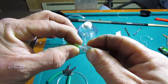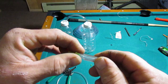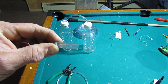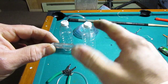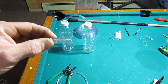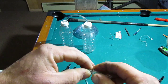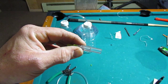I'll take this apart and attach it to a 10-foot piece — however long, it doesn't matter how long the hose is because the vacuum is going to pull just the same. You're looking for a vacuum port on the load side of the carburetor, which is the engine side. If you have a butterfly valve that opens and closes via throttle, you want to find something on the engine side of that for accurate synchronization. With the Mikuni round slides it's a perfect situation because it already has the port. I'm going to cut two 10-footers, fill this with two-stroke oil, go outside, and hook it to the machine to balance the carbs.